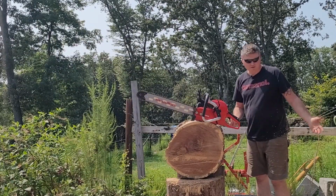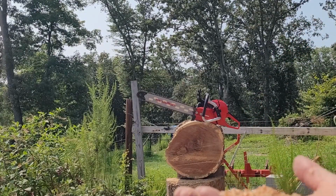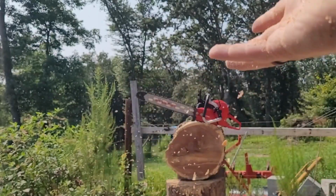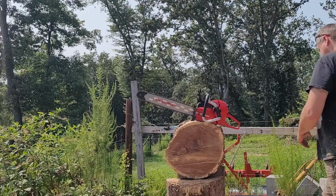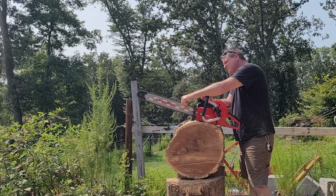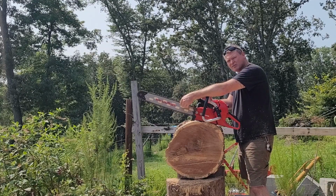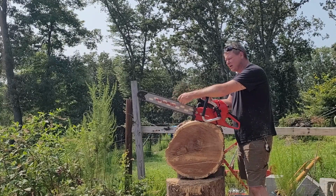I don't think it's any better than it was last time. The chips, I mean, typically in a situation like this, what I tend to do is I go and take some more off the rakers. And then it just becomes grabby and harsh.